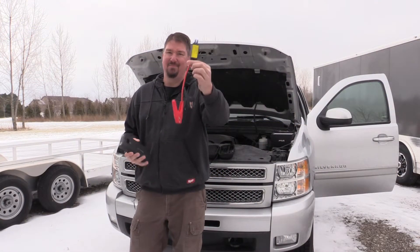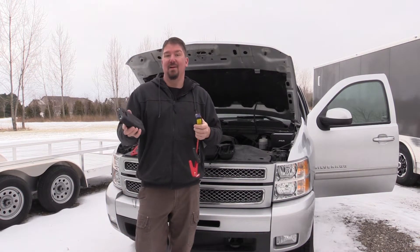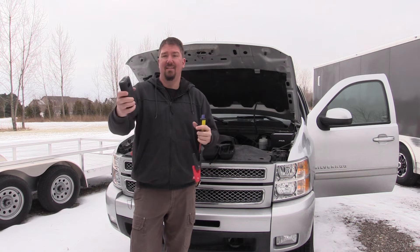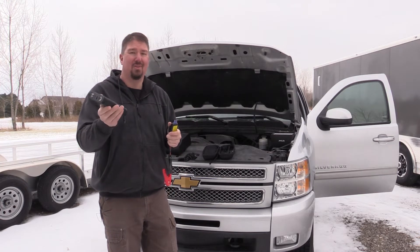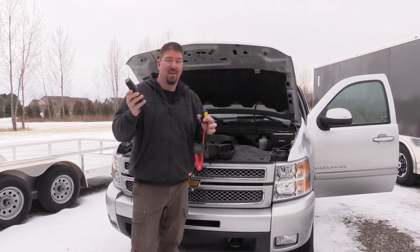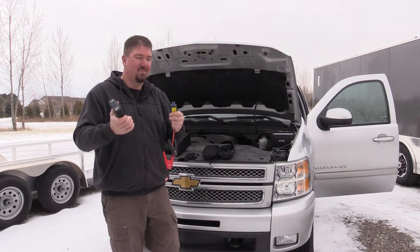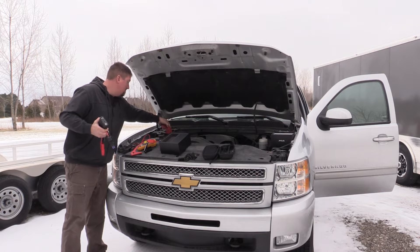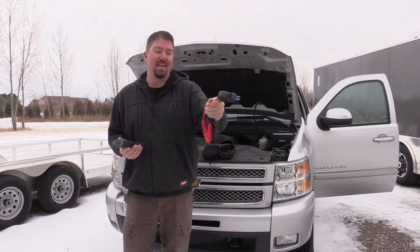All flowing through these wires. This is the difference here. We can look at the milliamp hours and compare — it probably has one more cell inside than the Arcan. So if you're looking at these, this is probably somewhere in the realm of 230 amps maybe, a little bit more, but just trying to keep it real. These are not going to throw 800 amps — there's no way you're pushing that through here. If you look at the cables on the truck, they're much, much larger than that for starting and running power, and you're just not going to push that much through here. This is an eight-gauge wire.